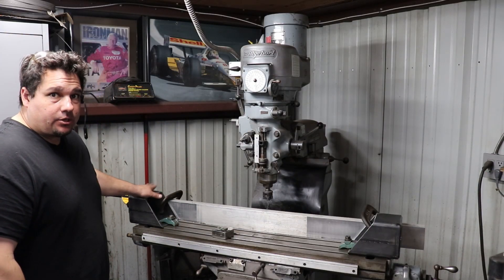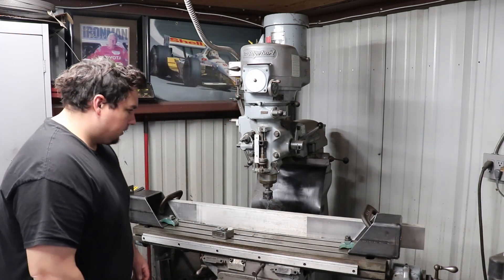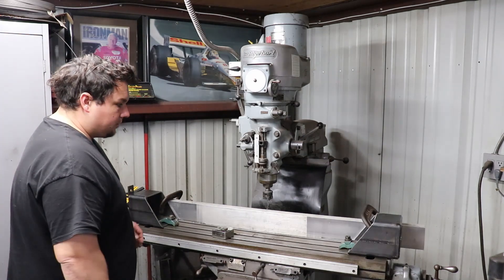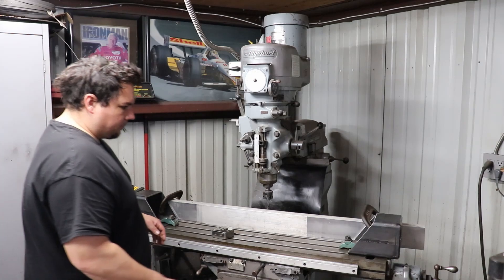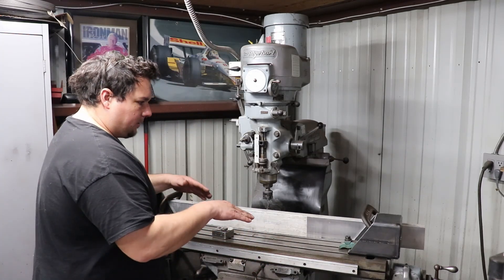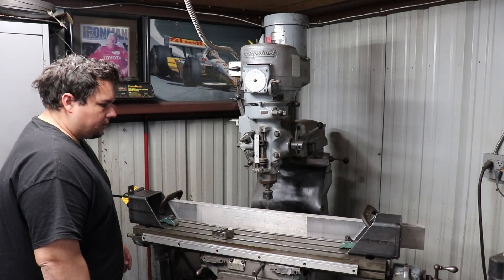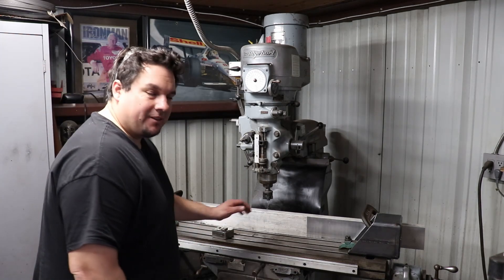I have these two pieces that I got done last night. I welded the plates onto these blocks. Now I have these two squared up to this piece of extruded aluminum channel. I have it clamped here and here, which keeps it nice and square. Then I took a tape measure and went from here to the edge of my mill table and got that perfectly square. Last but not least, I clamped it down here — it keeps it square as far as that plane goes. So I have it perfectly square in three different dimensions. Now that I have my width perfect, I'll be able to make this tube that goes across here, tack it in, and weld it in — because I'm treating my mill table as my fixture since it's nice and flat and square. Let's put that bar in.